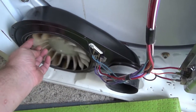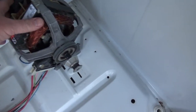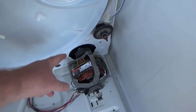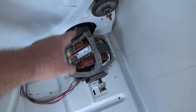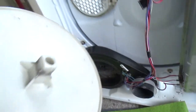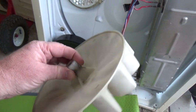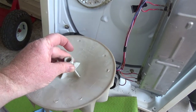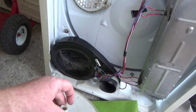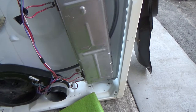There's a trick for attaching the fan: get a flat pair of lock-jaw pliers. You can put a wrench on the square shaft end — that's why I need to take the back clip off first. Put a big crescent wrench on this, lock the front of the motor, and just tighten this down. Don't reef it on so tight you can't get it off — just snug it up. Do that before you put the motor on.